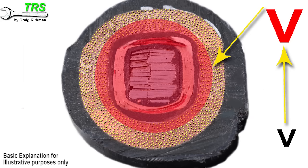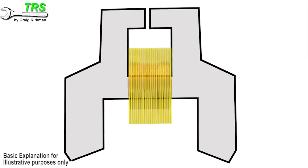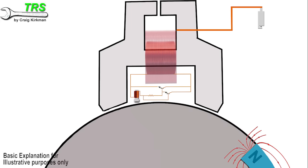What happens to these thousands of volts of electron flow current inside the secondary coil? This current only exists in the split second that the electromagnetic field is collapsing. When the magnetic field collapsed, this electrical current needed to go to ground — all of these negatively charged electrons are attracted to something more positive, because opposites attract. The attraction for these negatively charged electrons is to flow out of the secondary coil through the HT lead connected to it, over to the spark plug, to find the ground of the engine. And in doing so, it creates the spark. Each time the fixed magnet on the flywheel passes the trigger coil, this is what's happening — from fixed magnet to spark.